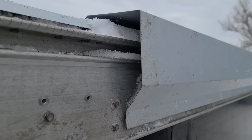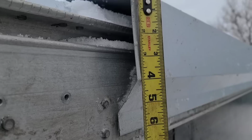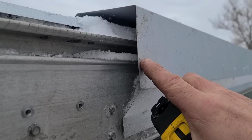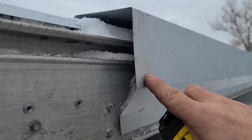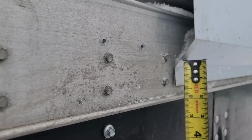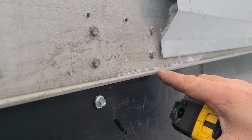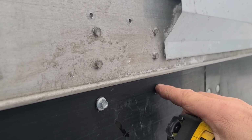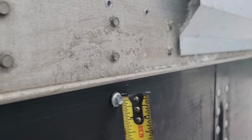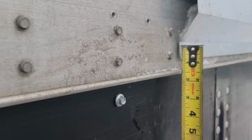I need rakers made that are just like these. But on this part that's 4 inches right here, they need to be six. This vertical part right here, if that was 6 inches, then that's going to allow this bent section right here to come down here and land where it's definitely going to be capable of missing this big bump. And then that's going to put us, I think, in good shape to screw this on and drive a screw right through that area there into the side of the trailer.